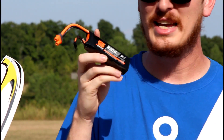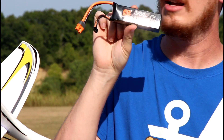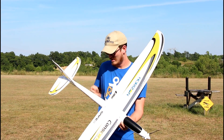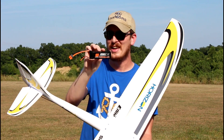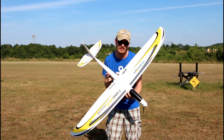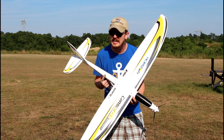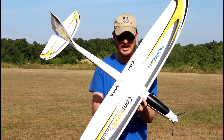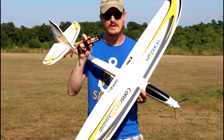Pairing this with a smart battery like the Spectrum 2200 3S is going to give amazing performance. The 4S pack is about the biggest battery you're going to be able to fit in here — it's designed to fly on around a 1300 milliamp battery. If you're a race drone guy with those packs sitting around, you can use those in this airplane and probably get 20 to 30 minutes of flight time. On a 3S 2200, if you're catching the right thermals, you can easily fly over an hour.